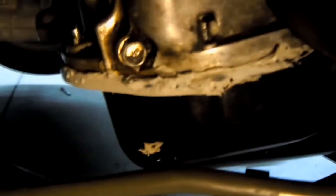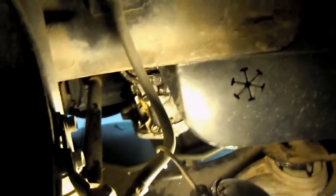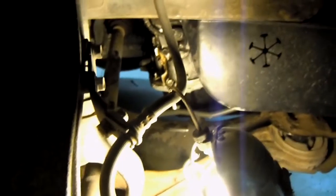Alright, so we've got the oil pan back up there. It's looking pretty good. Hopefully this fixes our leak. We got everything else put back together. Got the subframe back up, engine mounts, all that stuff. Now you just need to get the tire back on, lower the vehicle, and I'll probably warm it up in the garage a little bit to make sure that that gasket hardens, because it's currently snowing outside, so definitely not the best temperature to be trying to have this cure at. So I'm going to warm up the garage for it, give it a little bit better cure time. I'm going to get the tire back on, lower the vehicle, and I'll get back to you once I drop oil in it.